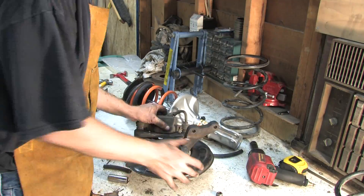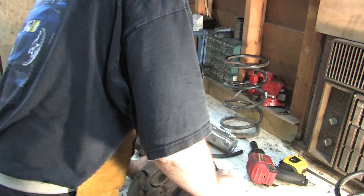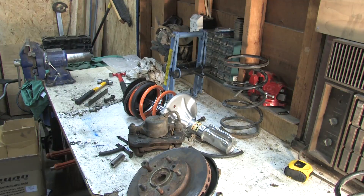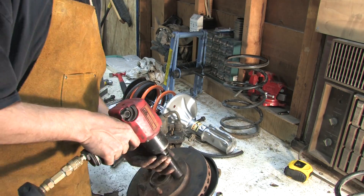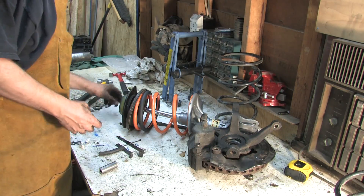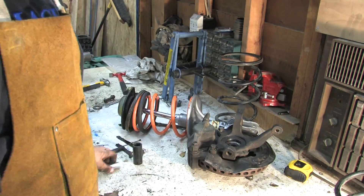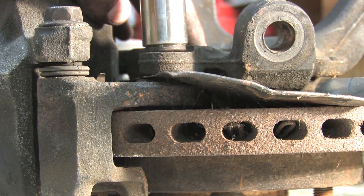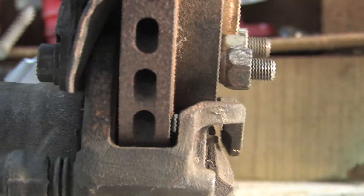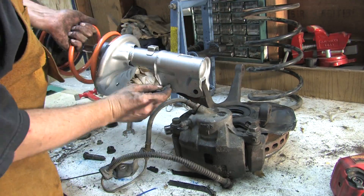As for the brake assembly, Expo brakes would work great for the four-lug guys, but Expo brakes have solid rotors that are more prone to heat soak than the vented DSM rotor. However, the four-lug Expo hub fits a DSM axle, and that opens up a lot of options for the front-wheel-drive crowd. Either one is a huge upgrade on this car. It appears that Turbo DSM or Expo brake parts line up flawlessly — I'm just thrilled the stuff I already had was a perfect fit.